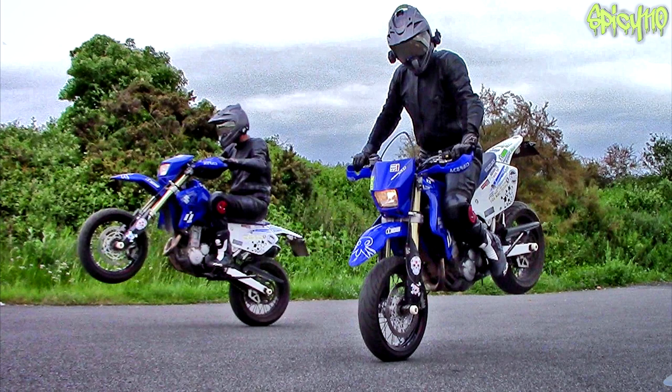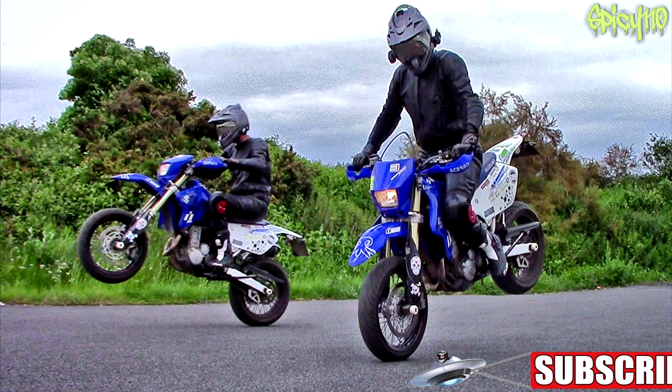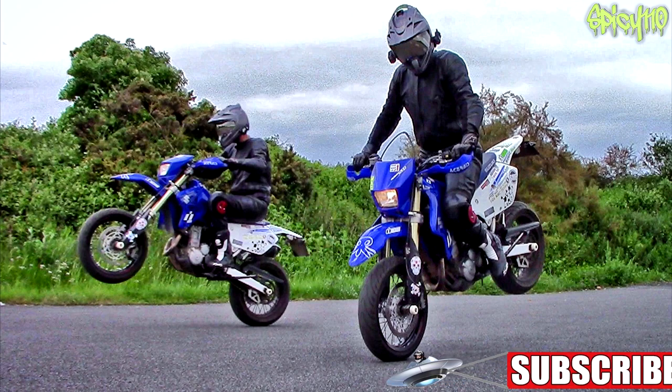I totally forgot to mention the things you should actually look out for when buying a DRZ regarding the engine. There are a few common issues worth looking out for. When you start the bike, see if it kicks out some smoke from the exhaust — if it's doing that, it's burning a bit of oil. A little bit might not be such a problem, but it gives you the idea that the rings might be on the way out, or you might have a scored bore. Original OEM parts to replace the bore new and piston is about £1,600, or you can spend about £350 on a 440 kit with piston, bore, and everything. That's one of the things I had to do to my bike — that's why it's a 440.